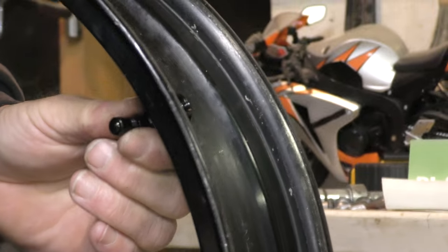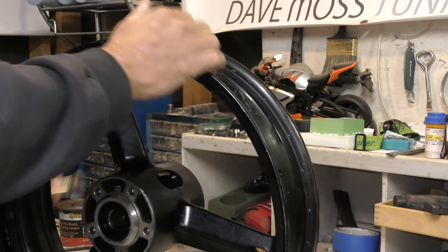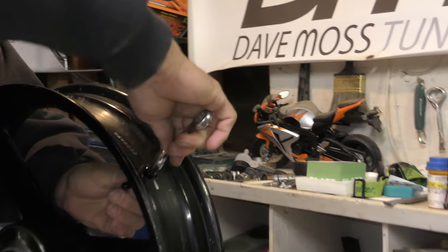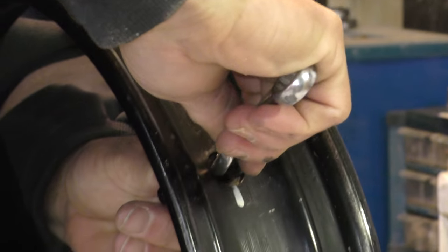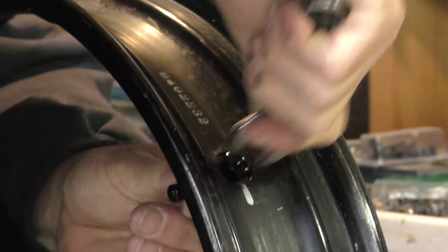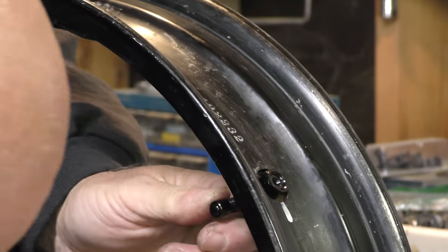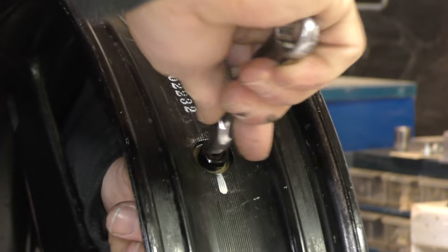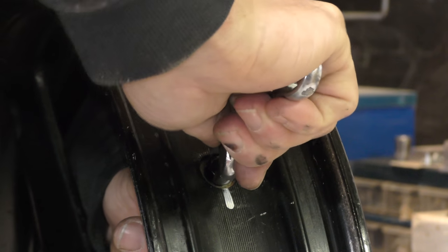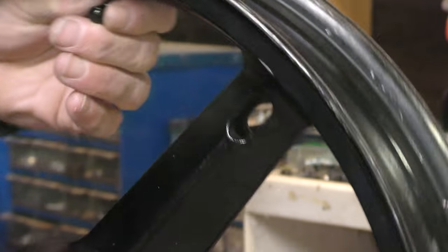Okay, now we want to make sure that that is 90 degrees and held correctly before we tighten it with a 14. So, now instead of going this way, I'm going to go that way because it doesn't need a ton of tension. So we'll work in one-face increments, checking as we go that this doesn't move off 90 degrees. So that's tightening up now. That's better. Now we're getting really tight. That's perfect. One more cinch.